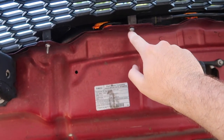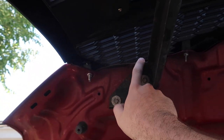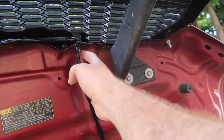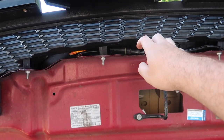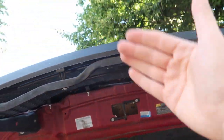As for the top part, you do have to loosen up that bolt, this bolt, that bolt — there's about one, two, three, four, five, and six. So six bolts up top — take out all those screws. And obviously, if you have an aftermarket grille, you'd have to disconnect all the lights before you can actually take off the grille, but that should be easy enough.